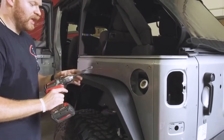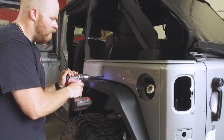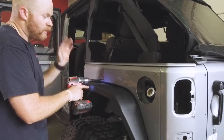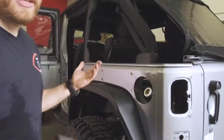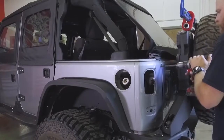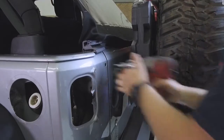One trick: while drilling with this big 17/32nds bit, pulse in the forward direction just until it's getting ready to cut through, then throw the drill in reverse and finish the hole in reverse. It seems to make a cleaner hole and causes a lot less tearing. Afterwards, take a unibit, countersunk bit, or a bigger drill bit and just clean up that hole so there are no rough edges on it.